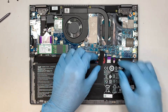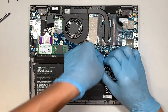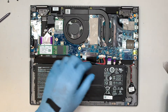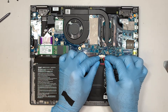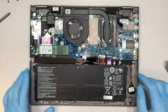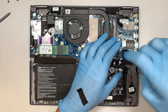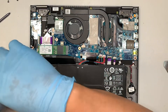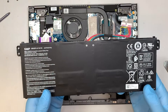This is the main battery, so let's go ahead and remove this tape. Once you have removed the black tape, you can slide the battery connector down towards your body — that's how you remove the connector. If you want to disconnect the entire battery, get yourself a Phillips screwdriver and remove the two screws, and now you can remove the entire battery.